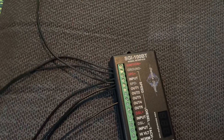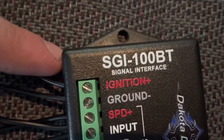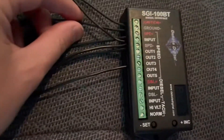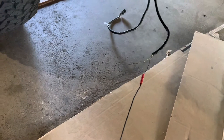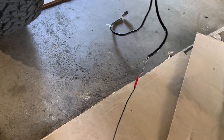To power the signal interface box, all you need is power and ground. The power wire from ignition-plus runs over to a fuse tap, and ground runs to a ground. The Jeep speed sensor outputs an 8,000 PPM signal, and the GM LS engine is looking for a 128,000 PPM signal.